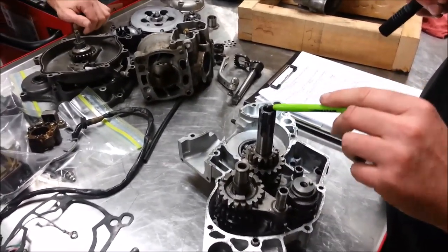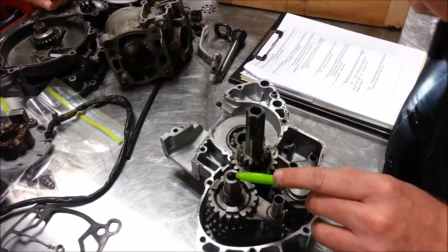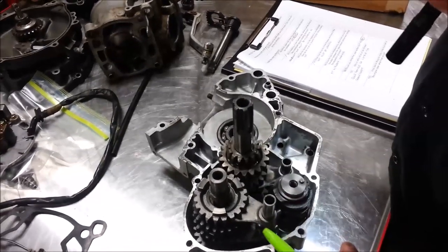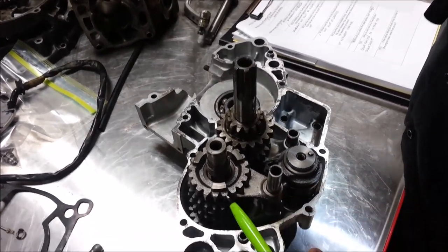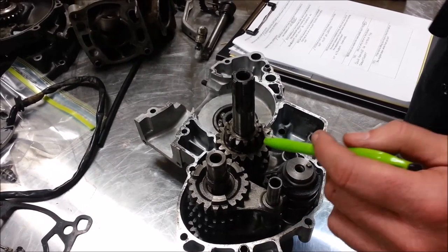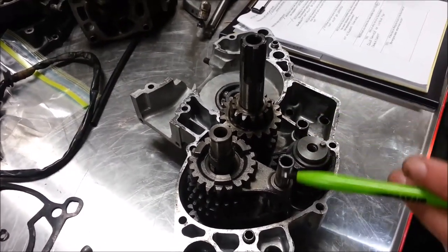When we gear up from the crankshaft, the first shaft we come in contact with is the main shaft, and the next one is the countershaft. To determine how many speeds are in a transmission, we don't even need a service manual — we just count how many gears are on one shaft. Five-speed means five gears on there, six-speed means six. The only time that could be a problem is if the vehicle has reverse.